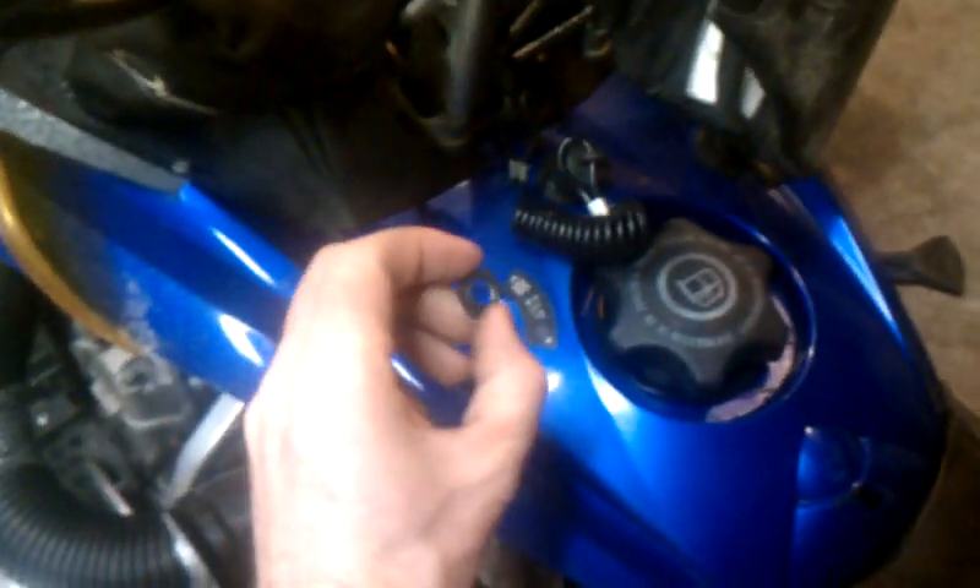I got a new hand warmer grip on there and I'm assuming it's a switch. There's a little nut you pull off, unscrew it, and it slides out. There are three wires here — one's the middle ground, one's for the high and low side. Make sure you take a picture of how it was on there and what side of the switch it was on so you can put it back together correctly.